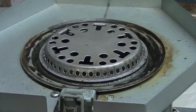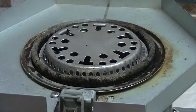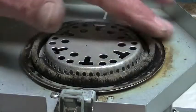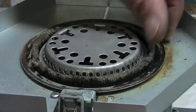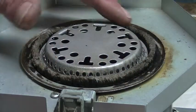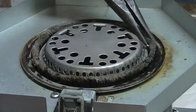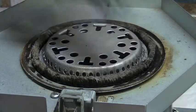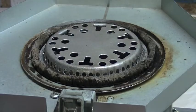Also, if you want your paraffin heater to work better, just wind it up. Wind the wick up and have a look at the condition of the wick. Sometimes you'll find that there's very hard black deposits all the way around the top. You can actually get a pair of pliers and crush them — you can hear them cracking. But the best way to do that is just let it burn dry.